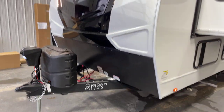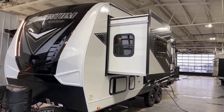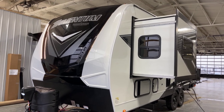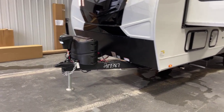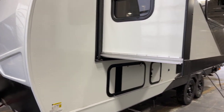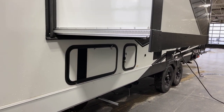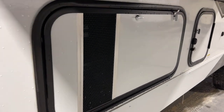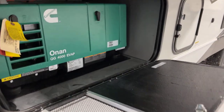This is a slide-out floor plan on the 21G. We're talking about an unloaded vehicle weight of 7,223 pounds, hitch dry at 1,059 pounds, and your gross vehicle weight rating is going to be exactly 11,000 pounds. You're going to be within striking distance of a well-equipped half-ton, but otherwise a three-quarter ton, you're going to be in good shape.